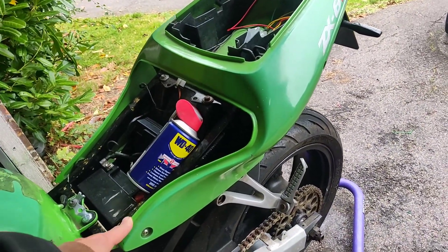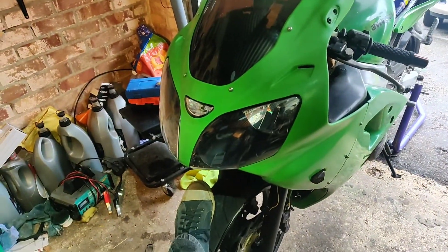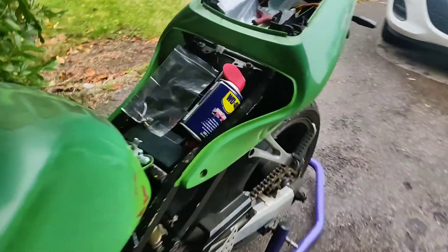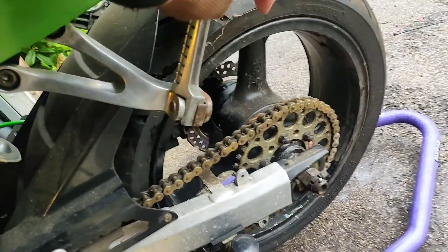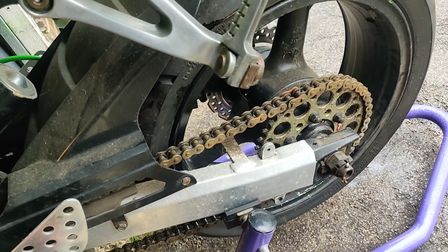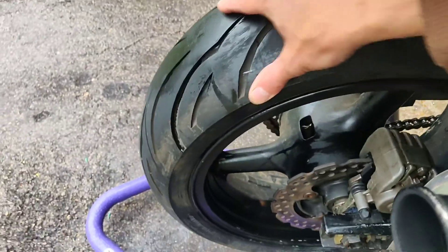So let's get on with it and see if I can get this back panel off. The thing that got me started on the panels on this bike was the fact that I've got no front mudguard — I might as well put the new one on, and it's kind of led me to just get on with it. So that's precisely what we're doing today. Just before I start stripping too much — having just taken off one bolt — I look down at the chain: the chain is supposedly new but it is rusty and crappy. I have a split pin, so I think what I'm going to do is split that chain, whip it off, and just leave it to soak in some old crappy fuel for a while. The other bit I forgot to mention: my new brake calipers arrived, so that's on and all set up and working perfectly.